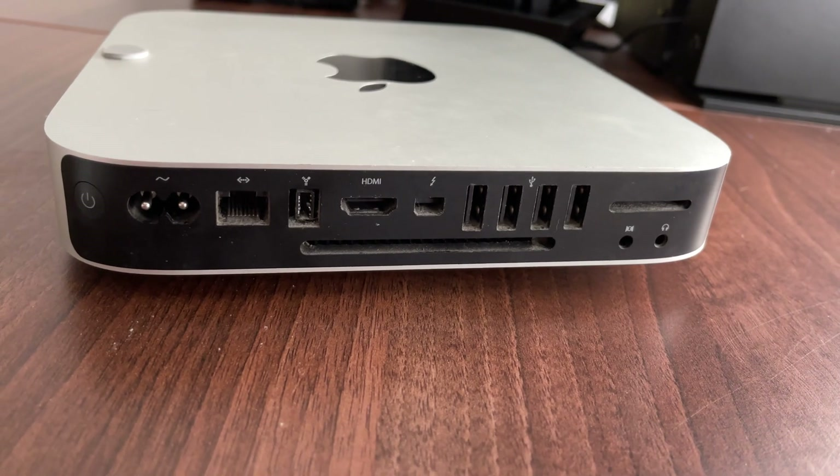As you can see, the hard drive is extremely easy to just whip out. There's just a micro SATA connector that connects it to the motherboard. You might notice there are actually two of those little SATA connectors, so you can quite easily put two hard drives in these machines. There you go — November 2013. So that's eight years old. There's the SSD I'm putting in to replace it — it's a pretty basic PNY 480 gig drive. That's all Matt needed for his purposes. And then I just carry on cleaning and dusting and getting all those years of grime out of there.